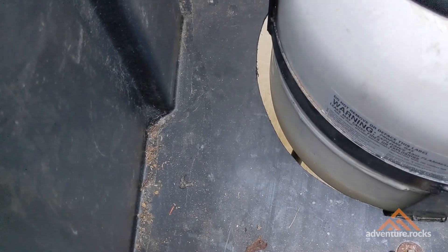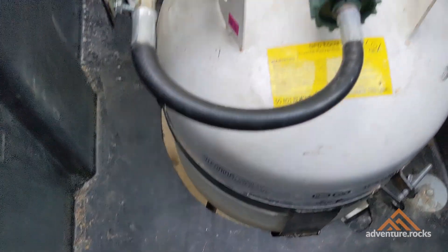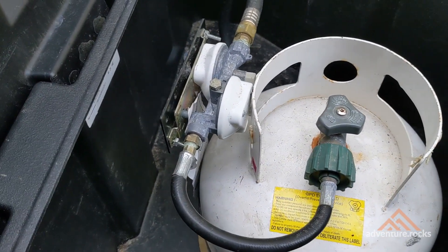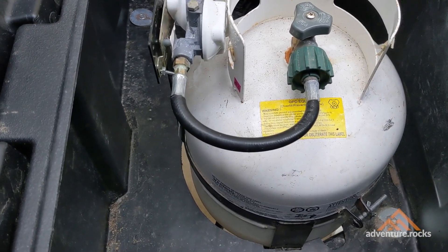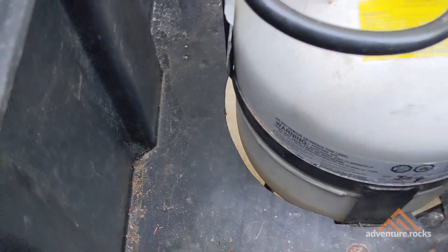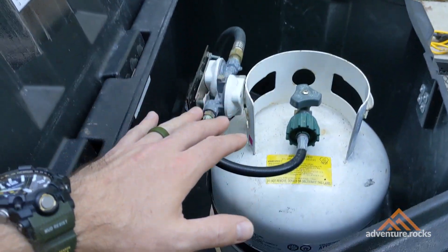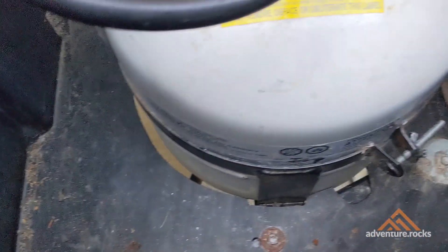The holder for the propane tank was welded to my A-frame, and so was the bracket that holds everything — you can't really take that off. I chose to leave a gap of about a quarter inch to three-eighths of an inch all the way around the propane tank, and this is actually a good thing. Propane is heavier than air, so most propane storage covers are hollow on the bottom so propane can drop down and exit. Having clearance around the tank also makes installation easier — after you make the cutout you're sliding the box carefully over the propane tank.